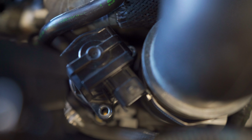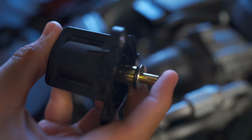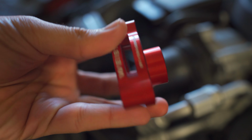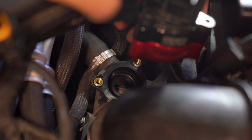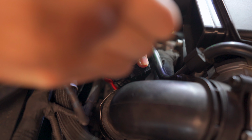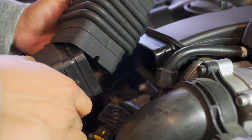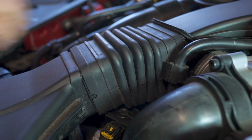Now that we've confirmed that the blow-off valves are working great with their new GFB guts, we can add in the Weistec external venting adapters and see if we can have our cake and eat it too. Stronger boost holding and that psh sutututuu goodness. Our one concern was the added height of the blow-off valve hitting the intake, but while it does touch, it doesn't seem like it'll be much of a problem.